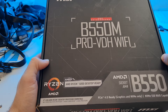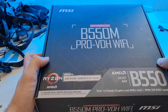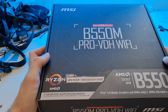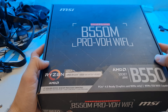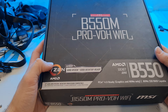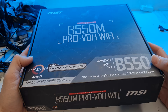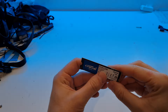For the motherboard, lots of people like to overspend wanting an ASUS Strix, but it doesn't really add anything to performance. We're using the MSI B550M Pro VDH Wi-Fi - a classic board we use all the time. It's decent quality, the VRMs have a nice heatsink, Wi-Fi is built in which is really important for a micro-ATX board, and it's got all the RGB headers you need plus a front USB-C header. There's really no point getting an expensive motherboard for a Ryzen 5 - this is going to be absolutely brilliant for our usage.